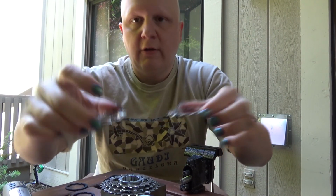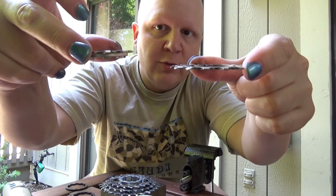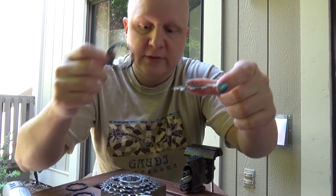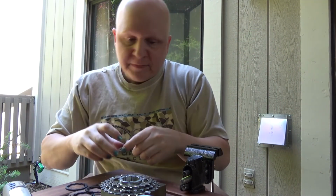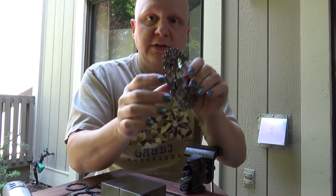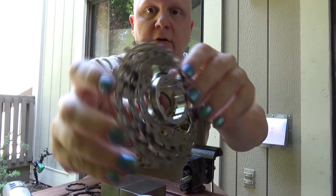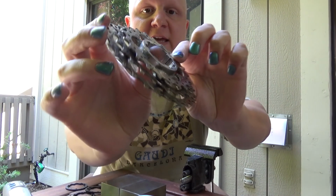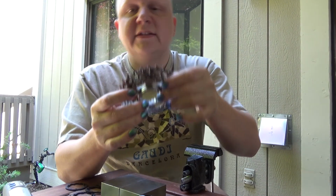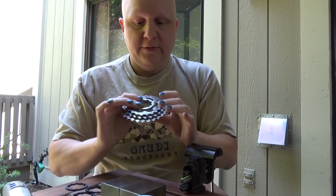what was this one, the 12. You can see the difference there. The 12 has a full thickness, this one doesn't, and it relies on just a plastic spacer. And then of course you have the spider for the larger gears, which is just fine because you have all 3 across, that much thickness, and it engages nicely on the center spider section. So that part's fine.